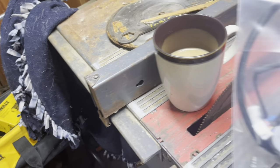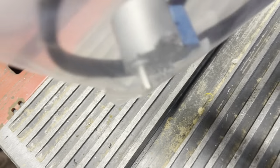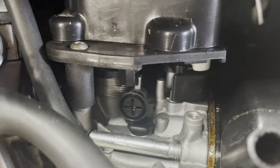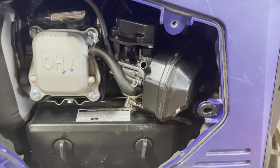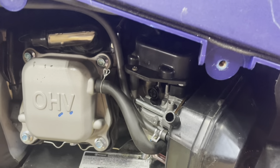This is the packet I got — that's the stepper motor that controls the choke. It sits in that black box and that little silver arm sticks down through the bottom, which is what the maneuvering pieces connect to. That's a little spring — I had to call and ask where that went. When I took mine apart I heard it fling off and couldn't figure it out, but they even sent me a picture of where it goes.